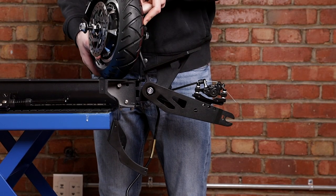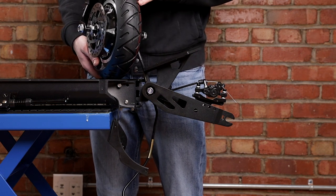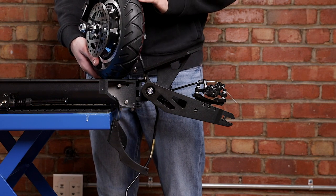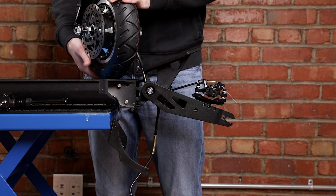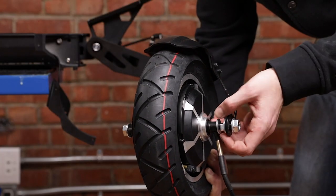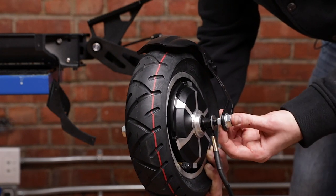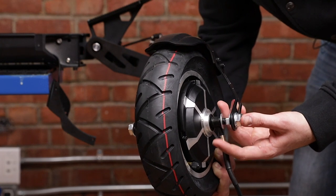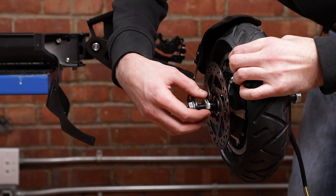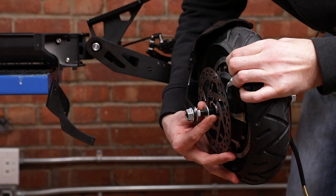Now we're going to start by installing our new motor back onto the scooter. If your motor comes without an inner tube and a tire already installed, please watch our video in the link in the description below so you can put the inner tube and the tire back on as well as the brake disc and everything else. Now we're going to have two rings: one on the inside that's without a hook — this one is just flat — and one on the outside that has a small hook. This small hook is going to go into the small hole on the scooter, and you have the same thing on the other side, so make sure that ring is on the inside and the hooked one goes on the outside.